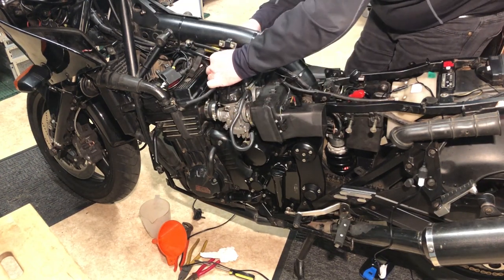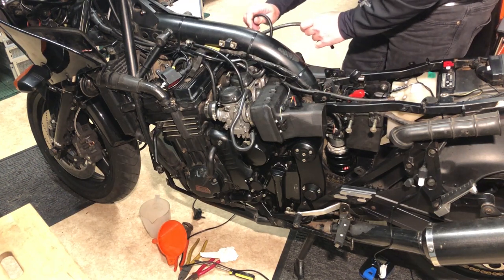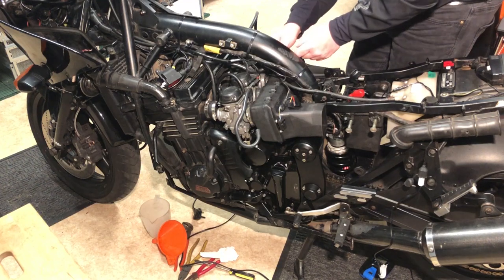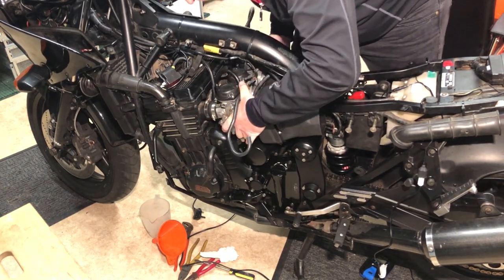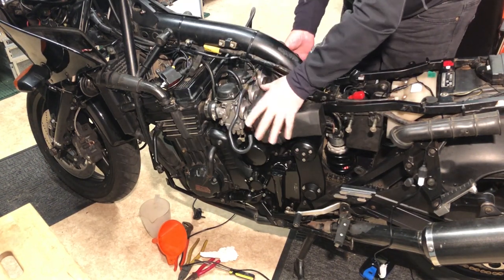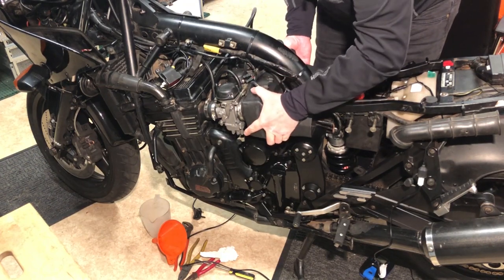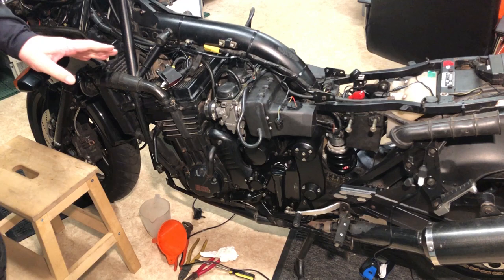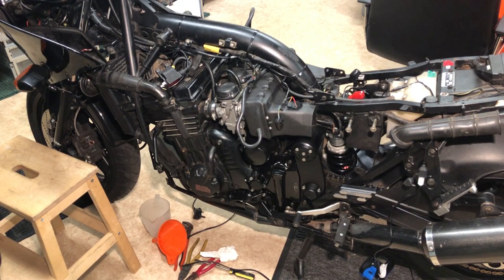It's all adjusted now — I've got free play at the handle. Just got to get these back in now without tearing all my rubbers off. I'll do the choke afterwards because that's easy to get to. It helps having that bit of soap on there, it does. Right, get these breathers sorted — that's my vacuum tube, it's a breather. Fuel line in. Job done on the engine side, so the airbox will go on nicely. Hooray — that's a nice good fit. I'll tighten the clamps up. Hopefully this is the last time these carbs are out — I've had them out so many times over the last 12 months.